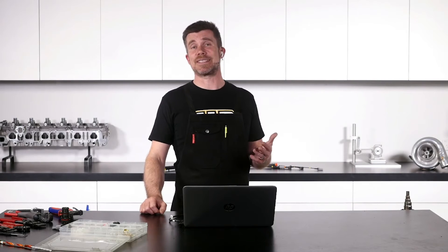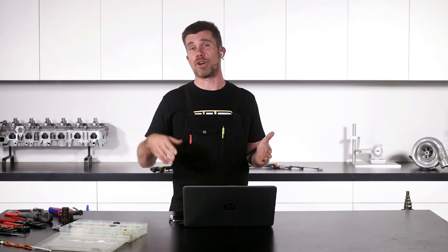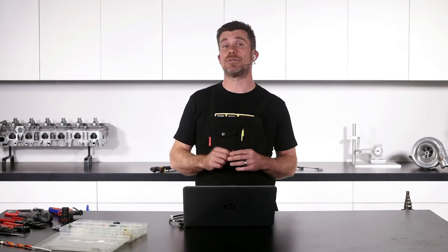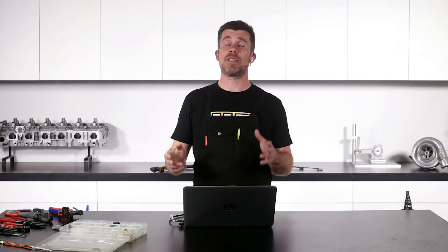What we can do then is basically make up a jumper harness that goes between your existing harness — so that'll just connect into this ECU header that you've bought — then make up a jumper harness, terminate that in the male ECU plugs and terminate that into your ECU. This is a great way of making up an adapter harness as well if you're putting an aftermarket ECU into a factory car.